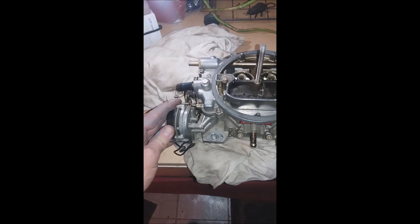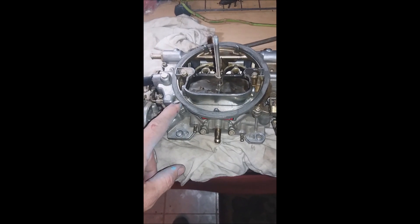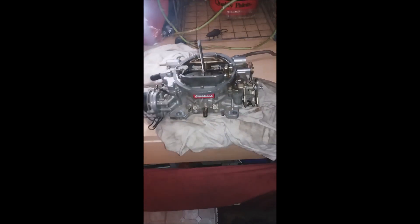As you can see, this whole process maybe took me 30 minutes max, and I replaced the jets, springs, and metering rods, which is the complete calibration and adjustment for this carburetor. So you don't have to be intimidated — it was only eight torx screws, the jets were flat heads, and the caps just pop right out. This is a really simple adjustment; just because it's a four barrel don't be intimidated. So that was it — basically calibrating my Edelbrock 1406 carburetor by changing the springs, metering rods, and jets. It took 30 minutes and it's back on the truck. Hope you guys enjoyed it. If you have any questions about the install, let me know — I've done this maybe three or four times now. Please post any ideas, questions, or comments below. Like, subscribe, all that good stuff, and we'll see you next time.